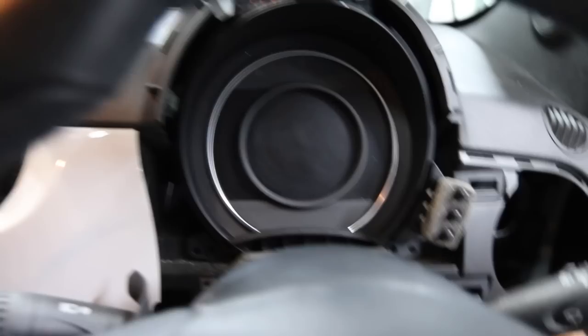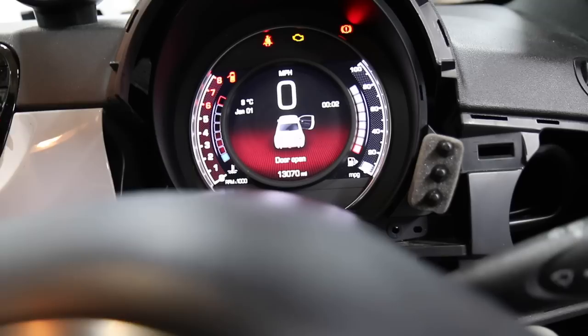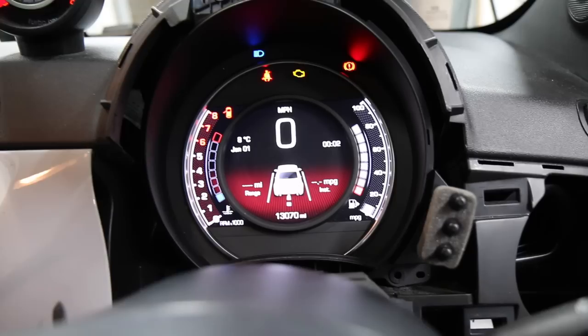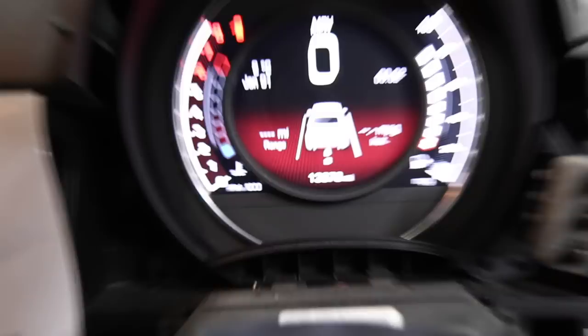The new clock is now in place loosely. Plugging it in is the reverse — just put in the multi-plug and once that's plugged in it's just a case of slotting the clock in place. Let's turn it on and see what we get. Doesn't that look better already? Fuel gauge is working fine, temperature gauge is working fine. Indicators left and right, and main beams — everything is working just as it should.